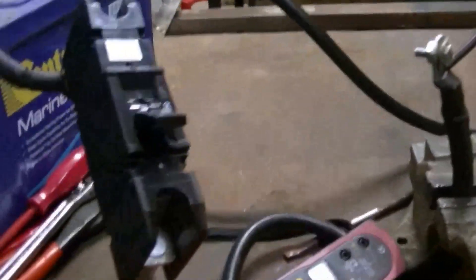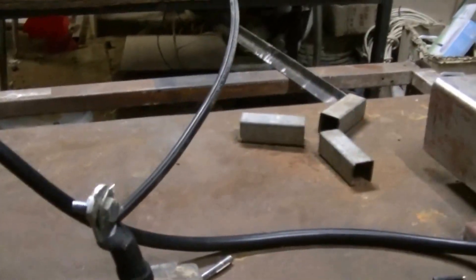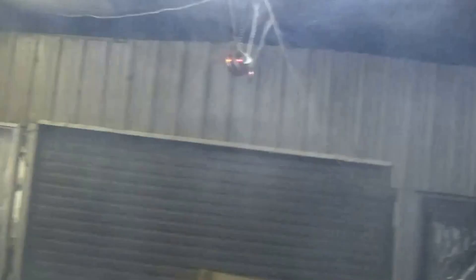Because the inverter wanted to go into low voltage cutout during our test, I'm going to show you what happens if you use too small a wire. We've got the amp gauge, we've got the safety fuse here of 250 amps, and we've got the wire here. So basically if you use too small a wire — oh jeez, it's smoking, look, we're going — oh jeez! The fuse is still not tripping! It's caught fire — oh shit, there's the mirrors — oh shit, I've got smoke in the mirrors. Lots of smoke — this thing!